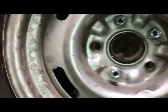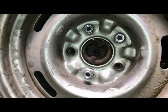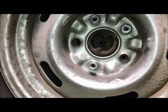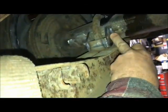So I'm like 2.5 inches lower than ride height, and I need to know that for my rear shock mounting points. But I think I'm getting off on a tangent here. What I wanted to say was, if you do a rear suspension and you use leaf springs, don't weld these perches onto the axle.